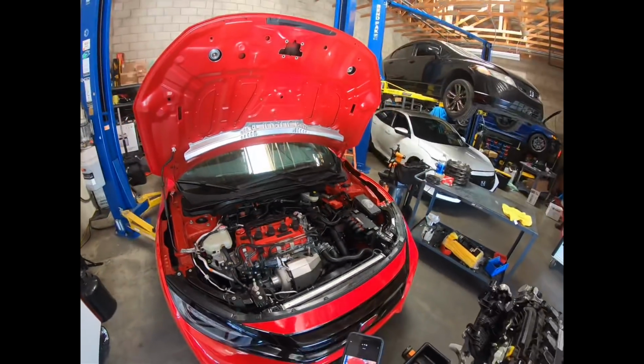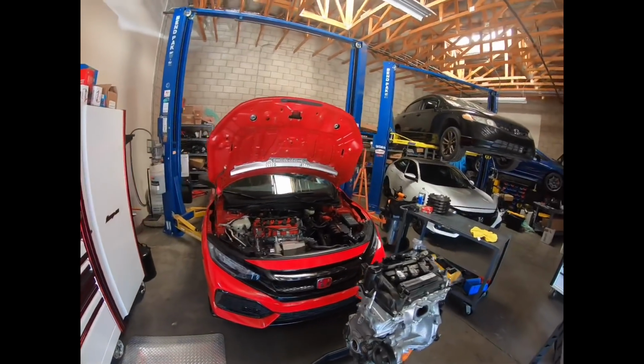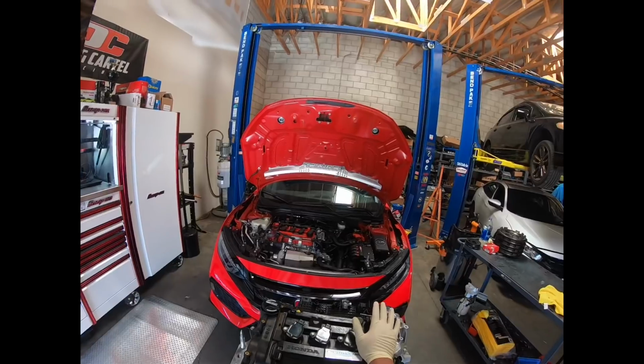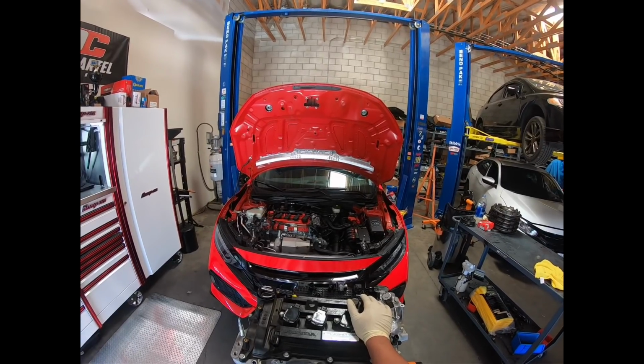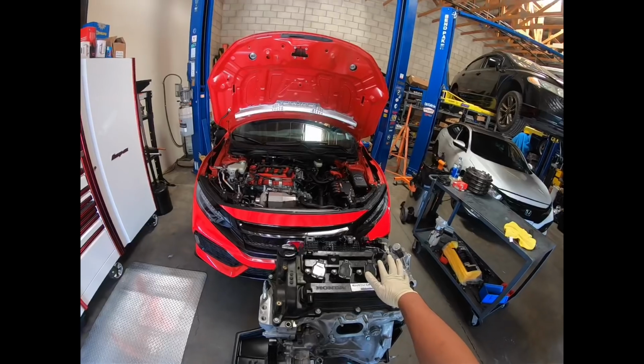The reason I decided to use that was because I was on Motec and I wanted the ECU to control the boost rather than using a boost controller and having all these auxiliary wires going everywhere. And in my opinion, the electronic boost controller is probably going to be the best way to control boost on these small engines. So we decided to leave that on.